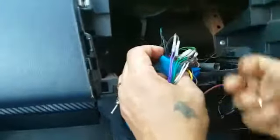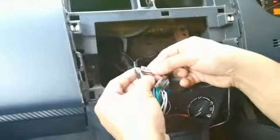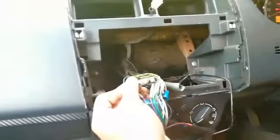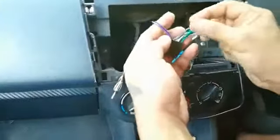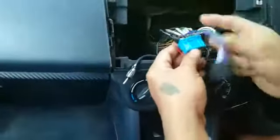The connector goes up, down, up, down — each pair of two wires goes to one speaker. To check the speakers, strip the cable ends and use a small AA or double-A 1.5V battery. Touch the two cable lines to the battery and you'll get a sound from the speaker, so you know which one is left, right, front, or back. Mark it, connect the left front speaker cable to the left front output, then check the right side the same way, and the rear as well.